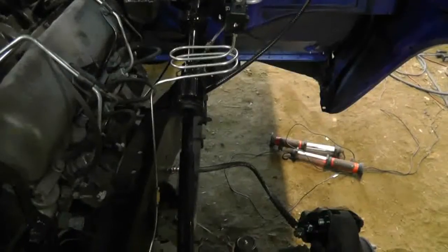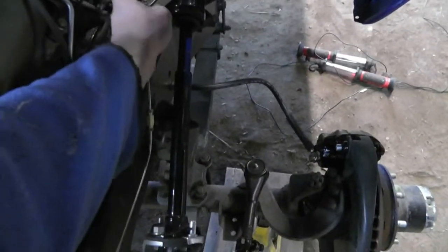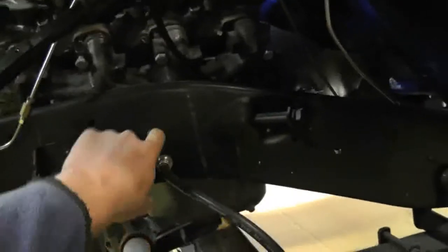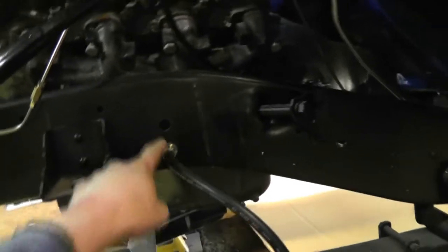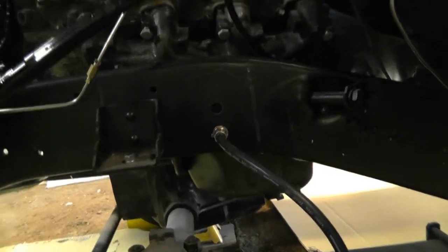The front lines are done. I don't have any clips, so it'll be clamped up tight against there, and I'll have to make sure that's out of the way so the two aren't rubbing — that is a fuel line. It comes across here at the front and down back in there. I just had to zip tie it in place temporarily so it would sit where I wanted. I originally tried to bring the line from the proportioning valve through here and hook it into the T behind there, but I didn't like routing it through a hole in the frame — even with a grommet, it just bothered me. So we'll do it this way and should be good to go.